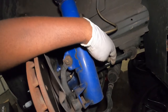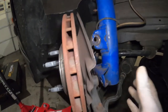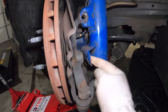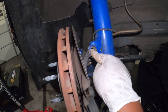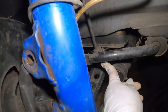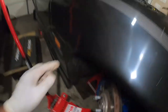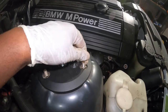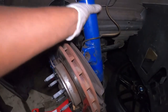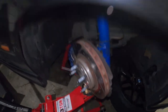To remove these two bolts, it helps to tilt the axle so that you have good clearance. I've removed those two bolts and you can see the sway bar is dangling on that side. Now I'm going to remove the ones on top — you can see how I've secured the rotors with the floor jack. Remove these three 13-millimeter bolts on top, hold everything on the last bolt so it doesn't drop, slowly lower the assembly, and remove the coilover. Pretty simple.